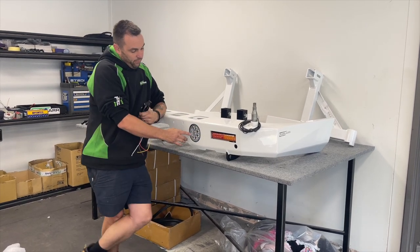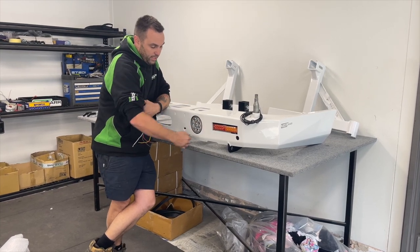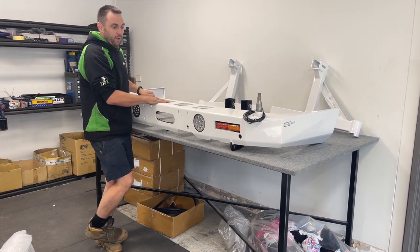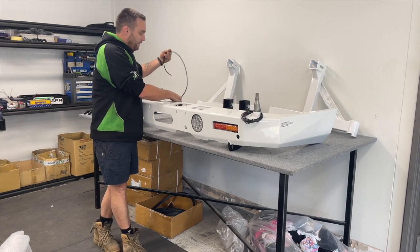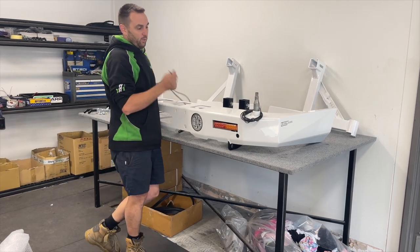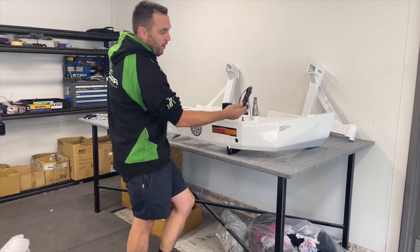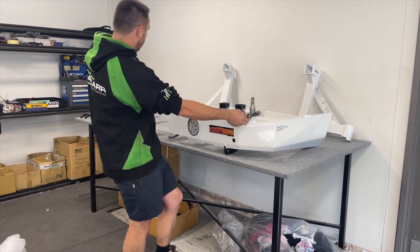The reverse light should fit neatly in the hole, so have them sitting in the hole first, then put your bolt in and nip them all up tight. Once that's all in, we like to pre-wire everything on the bench. We wire the reverse lights, tail lights, and everything into one tail so it's all linked. We'll come out with dual core for your reverse and five core for your tail lights, all linked together.